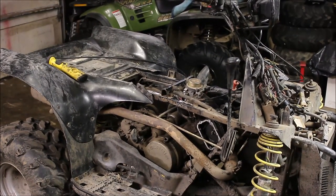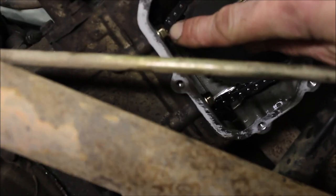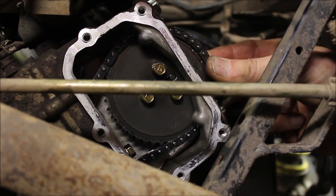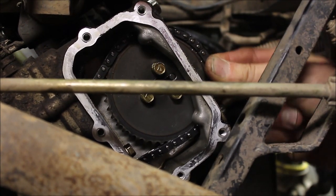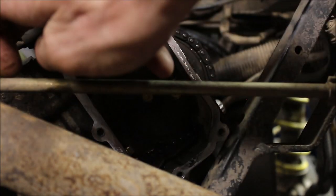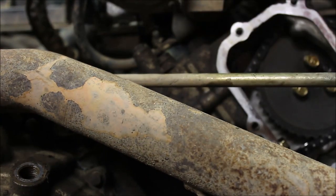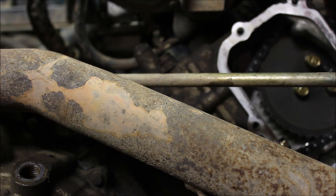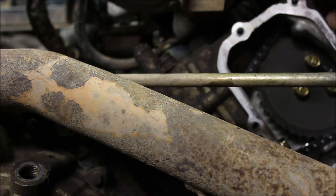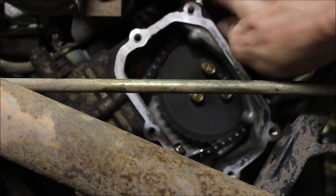The black smoke told me a couple things — the valves weren't opening correctly, timing was off. So the first thing I did was pull the rocker cover off to check the rocker-to-valve clearance. As I was taking it apart I noticed I had a lot of slop in the chain. I've also got a little bit of free play up here, which is not normal, telling me the chain has stretched and the tensioner up here is probably maxed out.